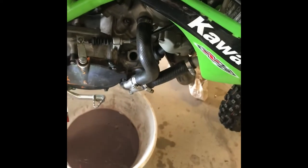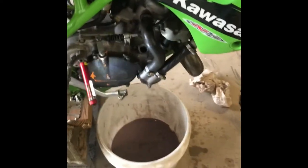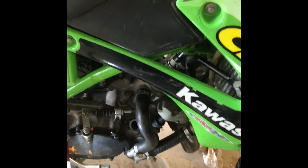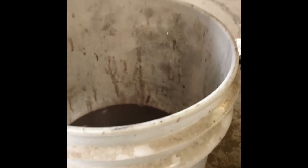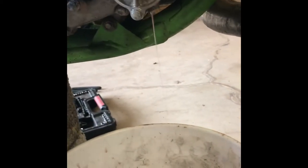I got about three quarter gallon of water, just water out of the hose, and we're just going to run that through the system to clear all that junk out — all that milky looking radiator fluid. Now it's coming out clear, which is good in a way. We'll just flush that all out. There's some more of that pink stuff — we'll run some more through it. Now with that, it just cleaned out our radiator.